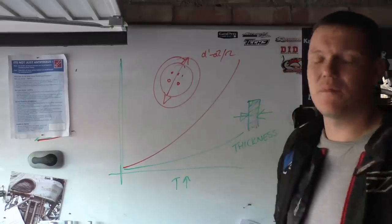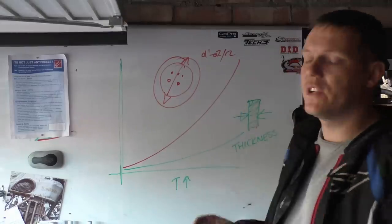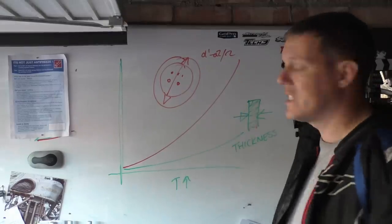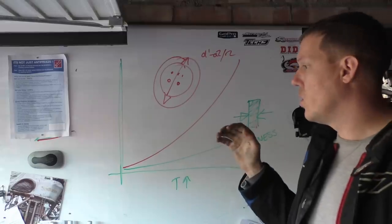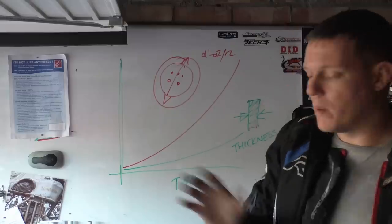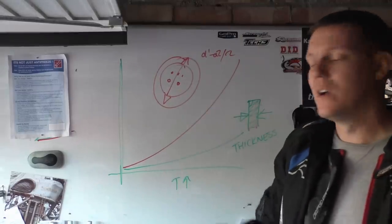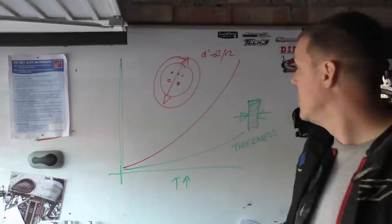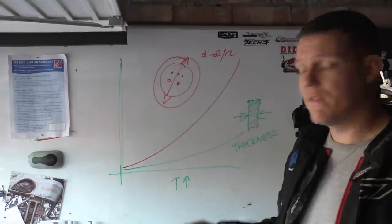Separating out the friction material, the friction surface, which is your disc, your rotor, versus your inner hub is very important. This allows for thermal expansion, and it's always radially outwards. So that old bullshit about bobbins, just fucking leave them alone. Like I say, the Z900 is brand fucking new. Then bobbins don't rotate at all. Hope that makes sense.